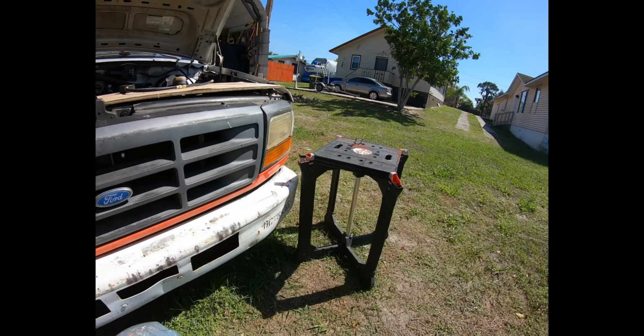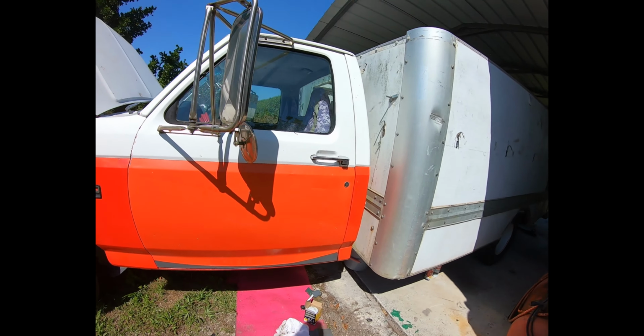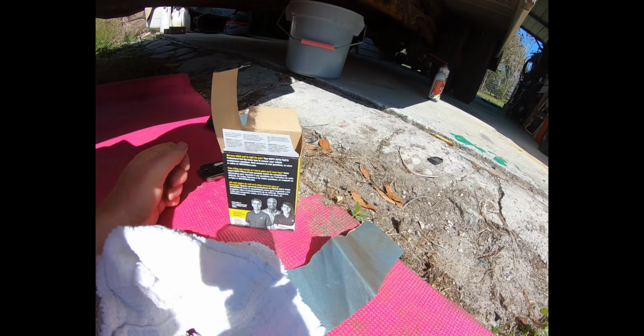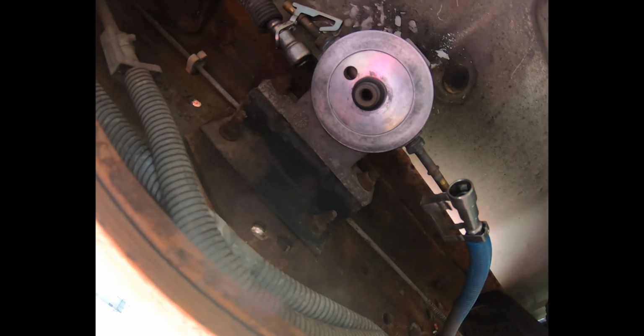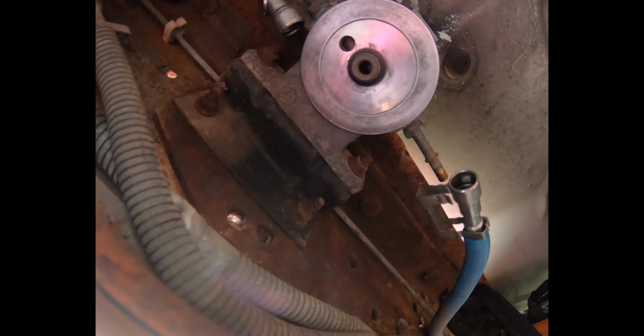And also, one thing on the fuel filter, it's underneath the cab on the frame, directly below the driver's side door. I had to basically chisel the old one off. I think the previous installers did not have a clean surface, because there was evidence of water right on top, between the seal and the O-ring.